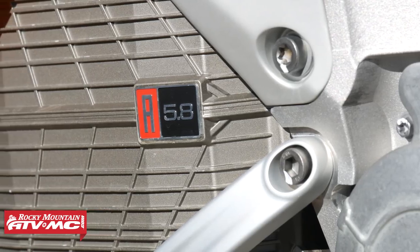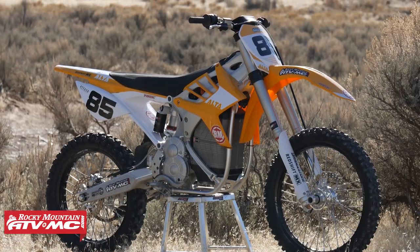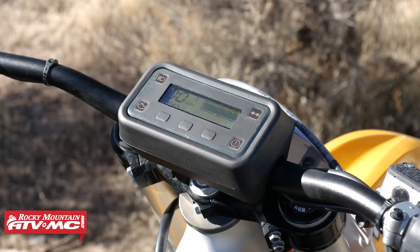Another nitpick that I feel needs to be better with these bikes is the battery life. This was a big question mark when we got it. We wanted to know how long they last and how long it takes to recharge. Depending on the map, you're going to get a max of three to four hours, but only 20 minutes on map four. When it comes to recharging, Alta says it takes four hours on their website, or two and a half hours depending on whether you're at a 110 or 220 volt socket. We actually plugged into a 110 and timed it — it took us right about five hours before the light came on the charger saying the battery was fully charged. So between four and five hours is about how long it's going to take to get fully charged.